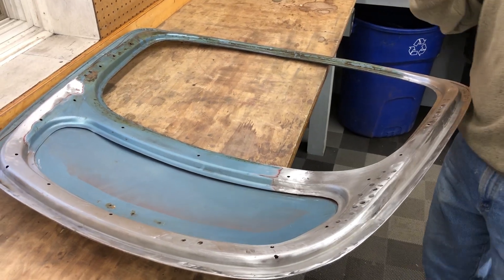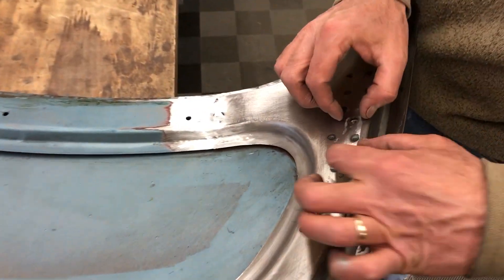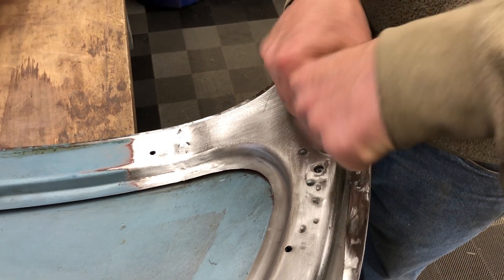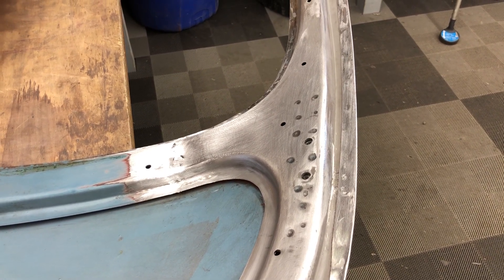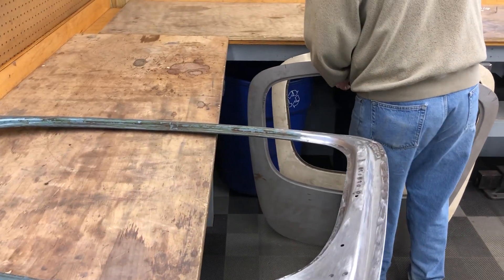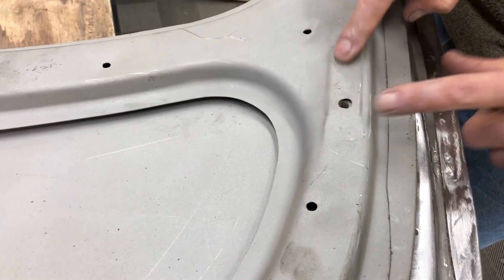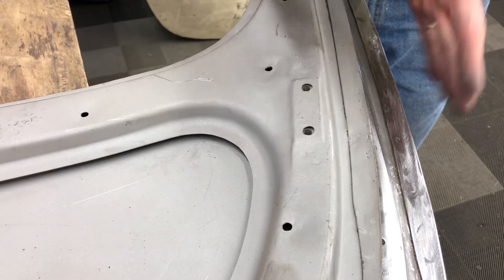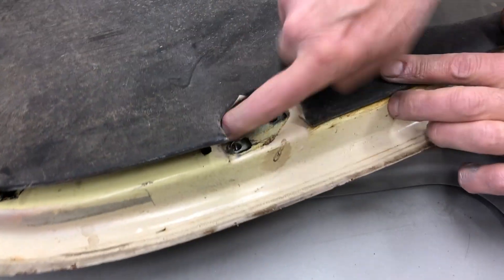But I had to do a lot more hammer and dolly work than I thought. And I figured out why they switched away from this design. If you look here, you see how this is a flush thing here and there's a caged plate under here, and it was flush for the bracket. This just wiggled and tore out of there. This is the other 61 hatch we have in the shop — this belongs to a customer car. You can see how this is all pulled up; there's just nothing back here to support this. These little spot welds are for the cage that holds that plate, and it's just really flimsy. I'm assuming that is why they eventually decided this isn't going to work, and they recessed it.